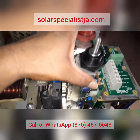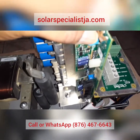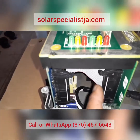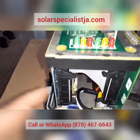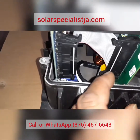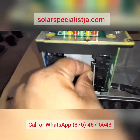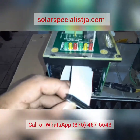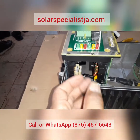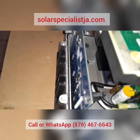Now we'll be able to lift our FET board from the entire unit quite easily. With our FET board out, we're going to remove this ribbon cable that connects the AC board to your control board, also called your computer board. Just lift the tab at the bottom and one at the top, and it comes right up. So now our boards will be free to be lifted out. First, lift your AC board to free up the space for the control board.